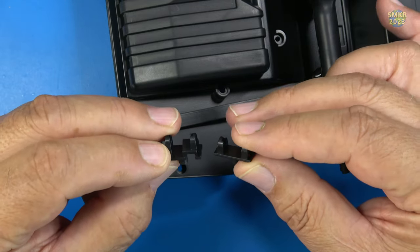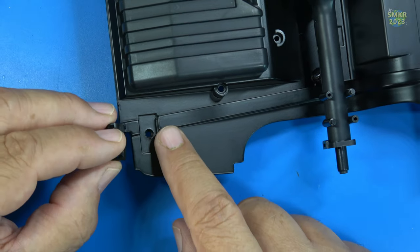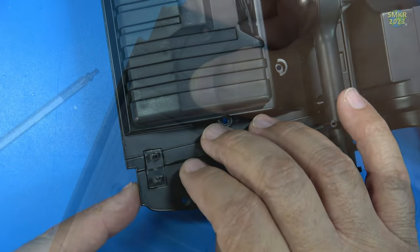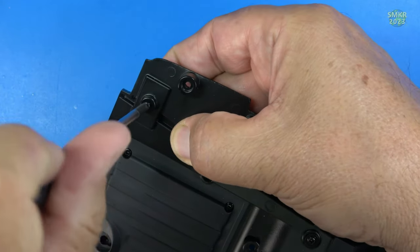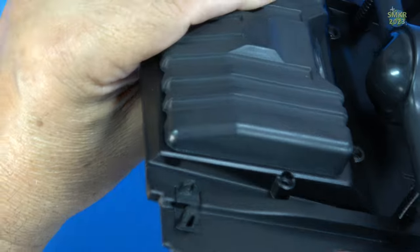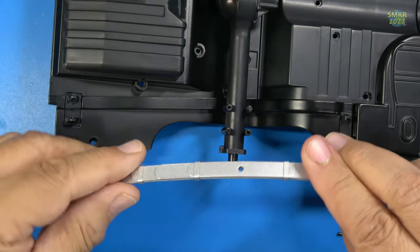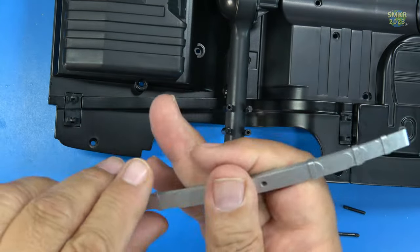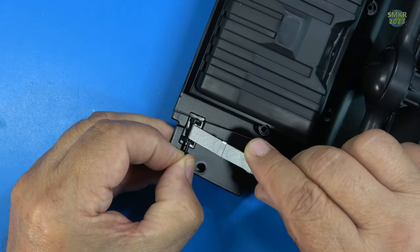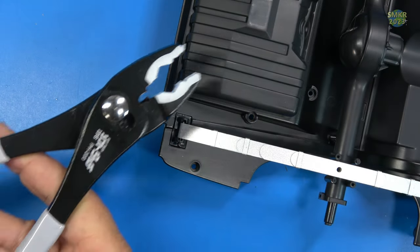We'll take the front hanger and match it up to the frame on the chassis, get it inserted, and a PSO5 screw goes in on the back side. Next I'll install the leaf spring — make sure the hole lines up with the axle, because if you go the other direction it will not line up. Simply put it up front and back, then put the pins in to lock it in. I have these nice little pliers here, called PH200s.